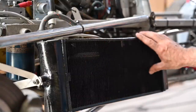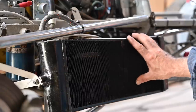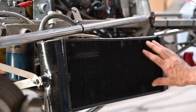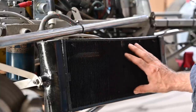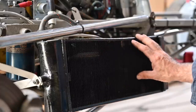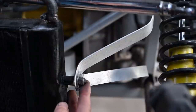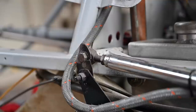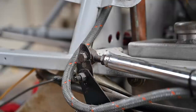The same thing is true on the top there for the swirl pot. This whole area looks so weird - it's like they inserted something with tape to make sure it doesn't leak. I'm going to change all this because this is just crap - you shouldn't be building cars like this. Cooling is very important in racing, so you want the radiators to have good cooling efficiency. There's a radiator on the left and one on the other side. I'm going to take these off and get the grid taken out and replaced by a high-performance cooling system. The radiator brackets in aluminum are cracked, so yes - radiators need to go out, reconditioned, and new brackets fitted.